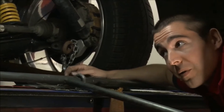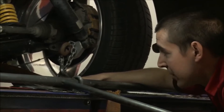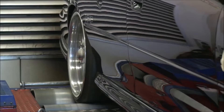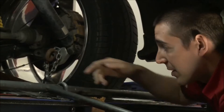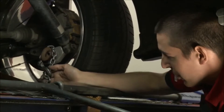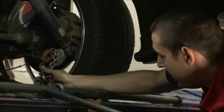What I'm doing here is tying the car down. Obviously, a car with this much horsepower — although we're pushing for 2,000 horsepower — it's very hard to make the tire actually grip on the rollers. It's very easy to get wheel spin. So we've got to tie it down extremely hard into the front and rear roller. I've got a chain, which is on a pulley system, with the pulley down in between the rollers, and I'm just going to hook that over there.